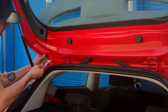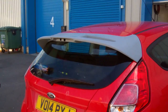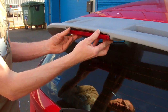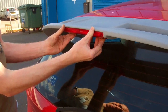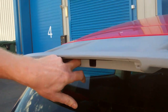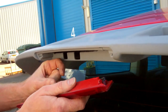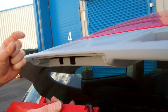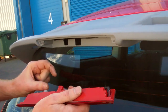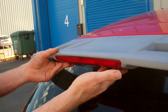One point to note is this spoiler is made from ABS plastic, not fibreglass like some inferior products on the market. Then you've got to put the two screws in — people can work out the rest of that. They come pre-drilled with the holes ready to go. There we go — that's the job, that's your ST look. One final addendum: the brake light. You reuse your old brake light — it's quite a snug fit. But you need to connect your electrical connection for the brake light and your hose. As we look at it, where the spoiler comes back further, the wires may not be long enough and likewise with your pipe. So it might be worth looking for a little bit of rubber pipe extension and a bit of wire to extend those, and then it will all just pop back in and fit with the same screws. And that's the finished job.